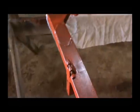Over here I've sprayed one light coat. I'll spray a light coat over everything and let it kind of tack up. I got my fan running right now just to help dry it a little bit, and then I'll come back and spray a second coat. Instead of sandpaper I've just been using my wire wheel on my grinder. I went and bought me a little Hitachi grinder - I've got a nicer Craftsman out in the other shop that's about an amp higher and you can really feel the difference in torque.